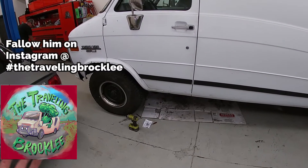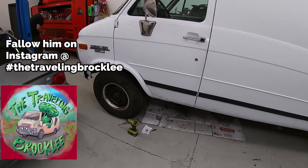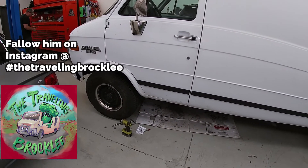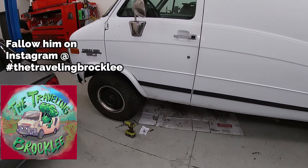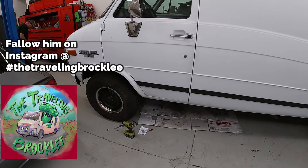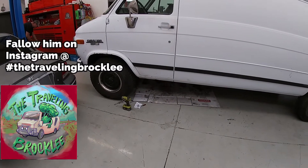This is not real uncommon for these or a lot of other vehicles — even the later ones with the 5.3s, 4.8s, and 6.0s. It's pretty common for those to break a flex plate, and not just on GM. A lot of Fords and Dodges do it too. These flex plates take a beating. Luckily, the part itself is pretty cheap; it's just the labor intensiveness of doing it.